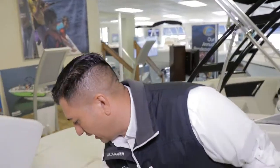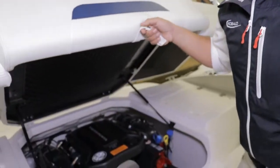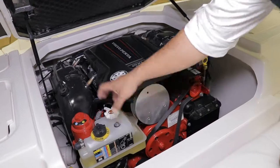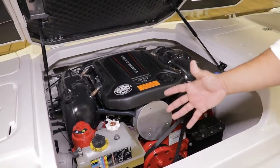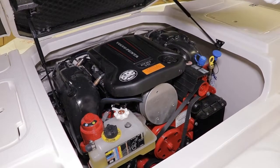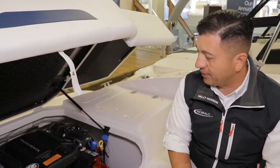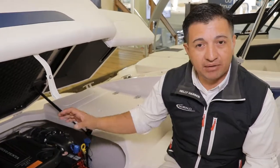Let me show you what this engine looks like. This is a V6 200 horsepower with a closed cooling system — look at the size of those manifolds. You can flush it from the top — forget about the engine muff or the old-style flushing method. There's also another connector on the transom where you can plug in and flush. This is the best engine for this boat — the Volvo V6 200 with a closed cooling system. It's a beautiful engine. I have no doubts at all about these Volvo engines.